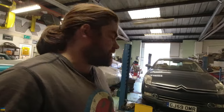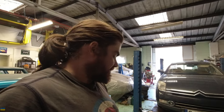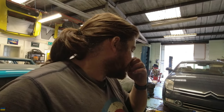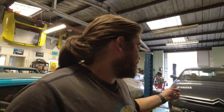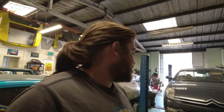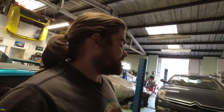The mic's died so this is me out loud. I was going to hook up the camera and go for a test drive, but once again I've run out of time — I had somewhere to be about half an hour ago. I don't think we fixed it, which I'm gutted about. I don't think the gearbox is sorted. I checked the oil level — I got into a bit of a funk because I think after all this work it's no different. I cycled through the gears to get the oil around the gearbox and got the level sorted, but when I was moving through the gears it was clunking and banging just like it used to.